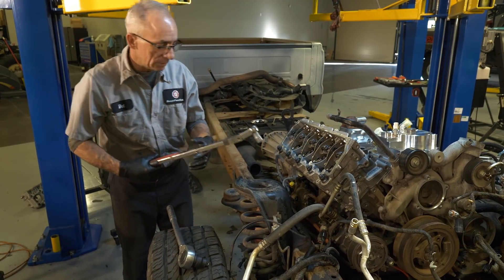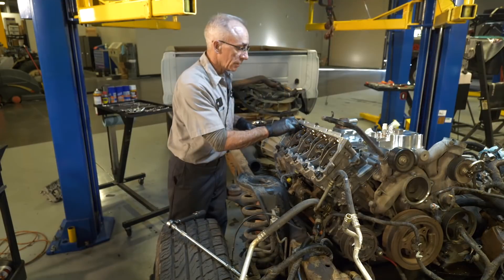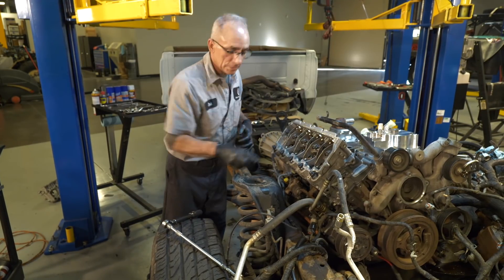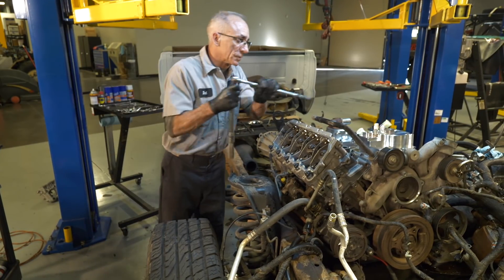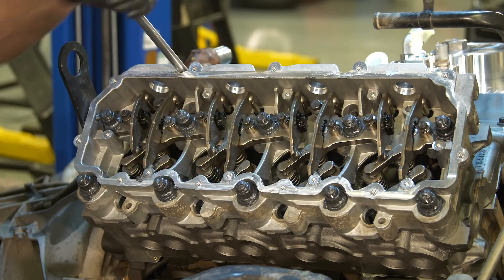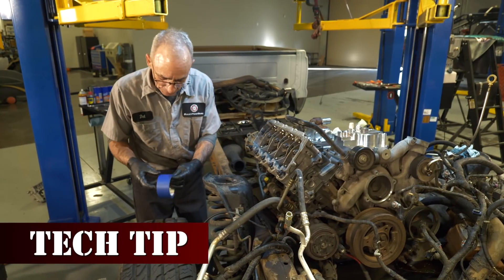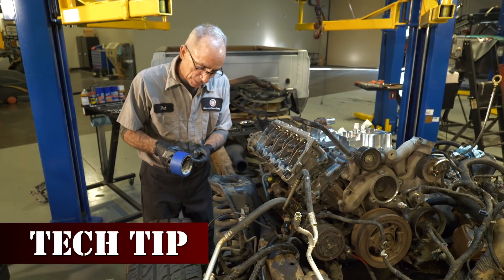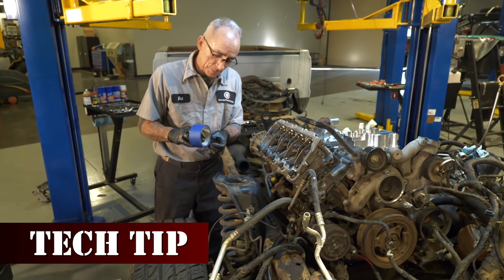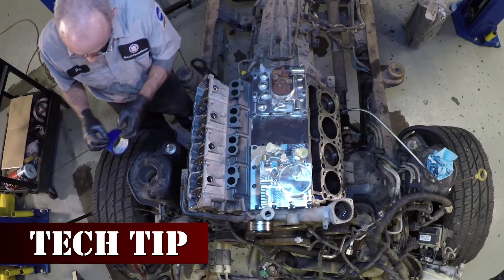The last round is 210 pounds. Let's finish putting the rest of the bolts in the head and torque the ones across the top to factory spec. From past experience, it's a good idea to cover up any existing holes because anything can fall in there and you're not going to know it until you go to start the motor, and it'll ruin your week.